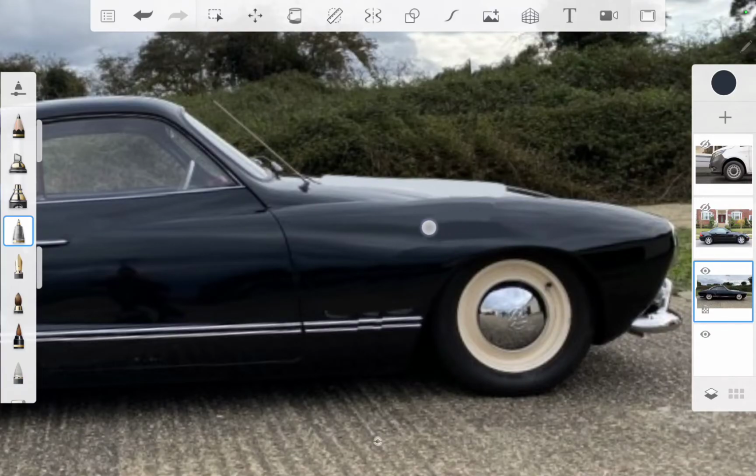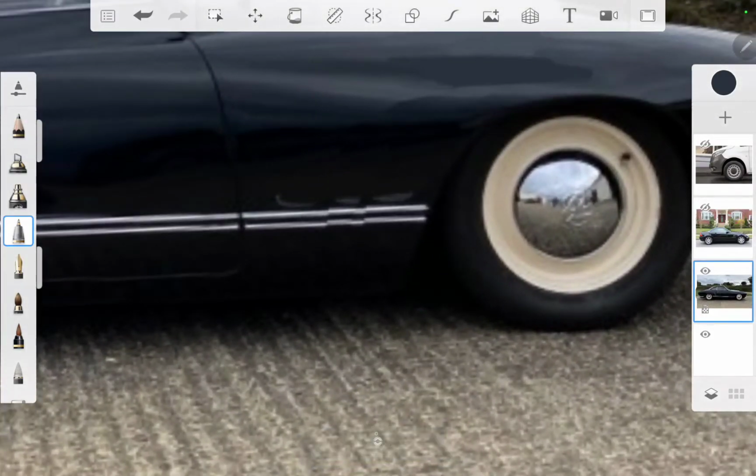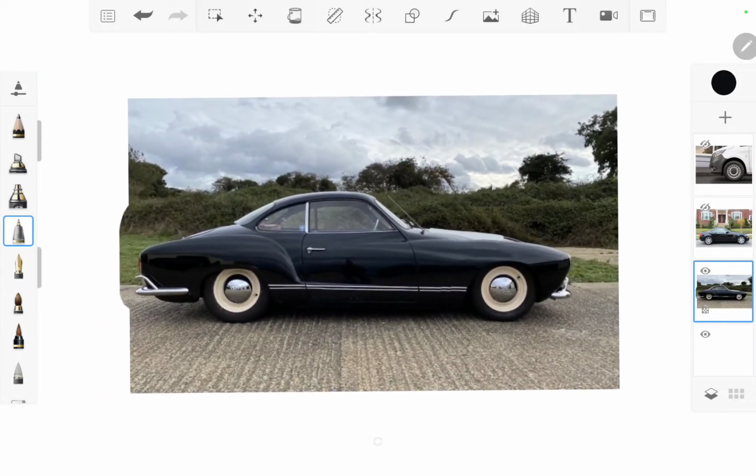The places I'm deciding to cut, I'm trying to keep them fairly consistent with flat areas so that when I'm welding metal to fill in the spot, it will be a little bit better. Not having to do the compound curves.